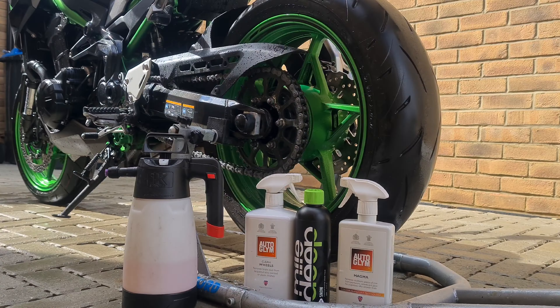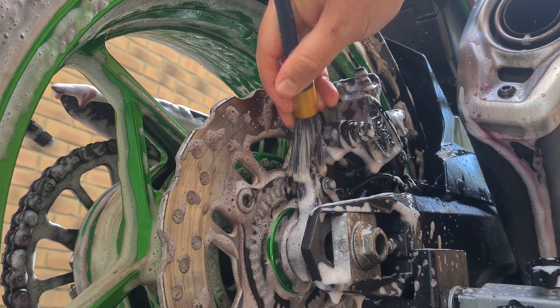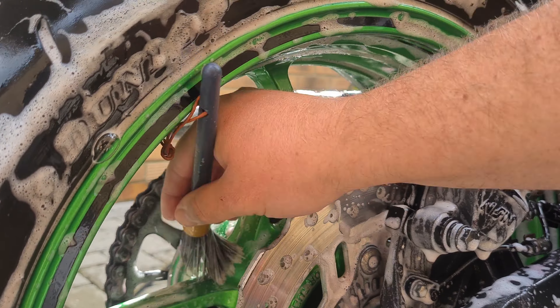Like a car, you'd start off with the wheels, but on a bike you'd also clean the chain. Start with the lower parts of the bike which are the dirtiest areas. You apply the same sort of products you would to a car — first a fallout remover, then a wheel cleaner, and top it with a snow foam, which is Mule Deep Snow Foam, just to give it extra dwell time. Then clean your tires and rims to remove all the dirt. The only difference is you're going to be cleaning the chain with a stiff brush to remove as much grease as you can, because this is what collects all the grit. You will also be lubing the chain at the end, which I'll show you how to do — this is highly recommended every time you wash your bike.